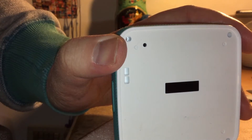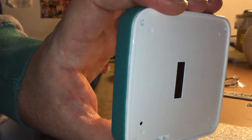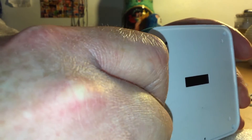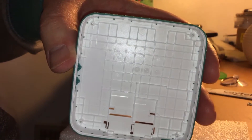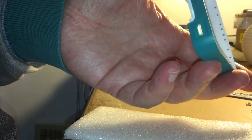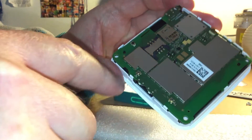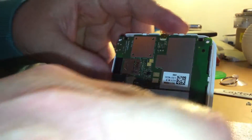Let's get the focus back again. You can see it's coming open. The top is going to come off any second now. When it does pop off, be very careful — there's an AMOLED display here that's connected by a ribbon cable flex to the main motherboard, so be careful when you pull it. That's the bottom part — that's the bottom part of the chassis — and the case here with a rubberised edge on it. Now to get this off you've got the standard plastic prong clip things, so lift those off. Earth yourself first by touching the radiator, then get your fingernail or a pry tool and pry these back.